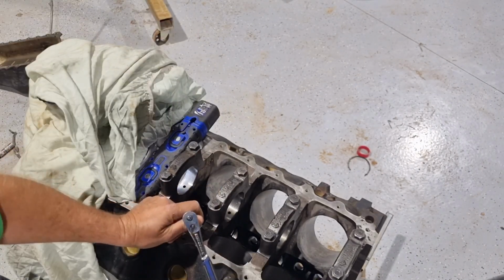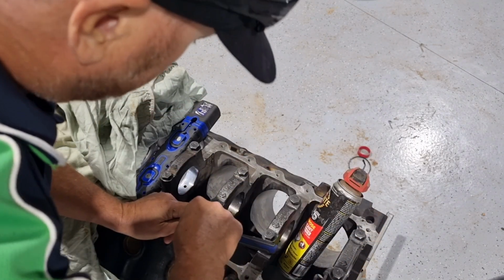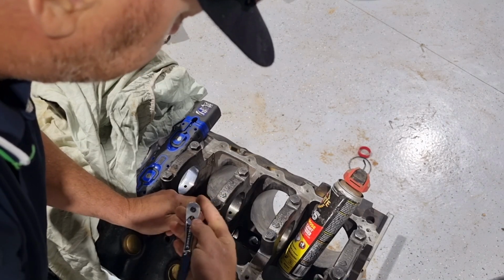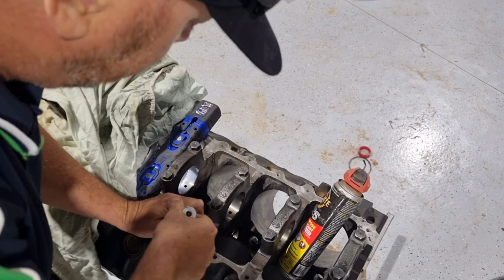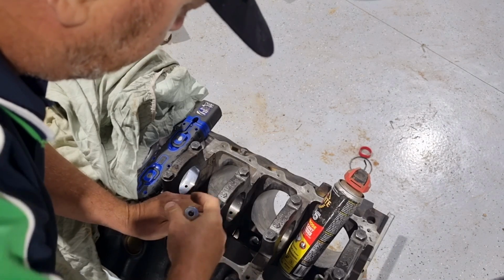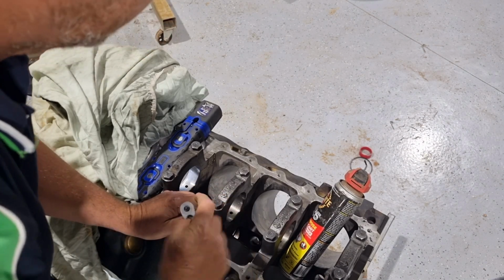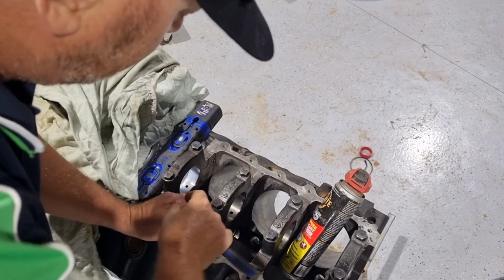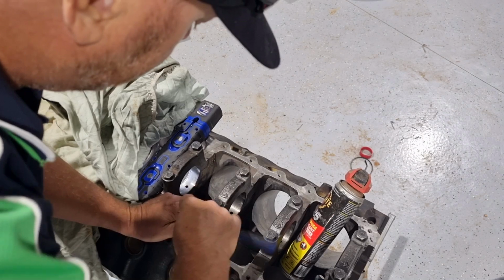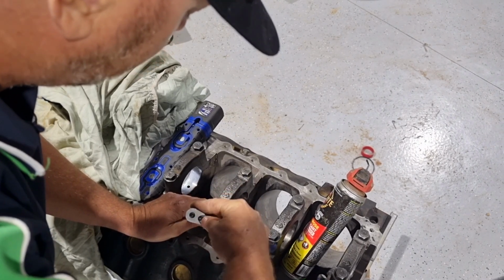When doing this job, always keep your lubrication up on your tap. And we don't want to go right through the whole lot. We just want to go down a few threads, give it something to bite on. And then it's a tapered tap, so it'll taper down. So when you screw your little bung that you're making, your grub screw, in, it'll screw down and sort of start to run out of thread. I'm going to Loctite it in anyway, but then it'll tighten down on the thread itself. So it can't go all the way through.